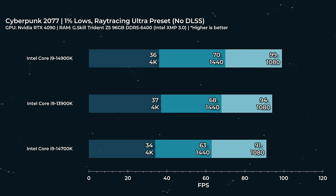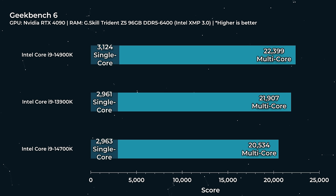Cyberpunk, since it's gotten the DLC update, seems to have gotten a lot more stable. Geekbench 6 single and multi-core scores also sort of confirmed this: the single-core score between the 14700K and the 13900K is basically identical; the 14900K is a little better but it's just fleeting boosts. You can also see how much of a difference losing four E-cores makes in multi-core performance — not a lot in the real world, but in benchmarks like Geekbench multi-core, Cinebench, V-Ray, if those workloads are important to you, it can make a difference. Outside that, especially for gaming, E-cores really don't matter all that much in most titles.